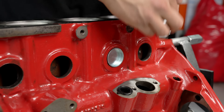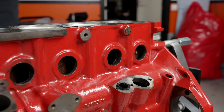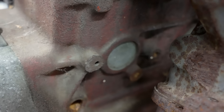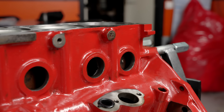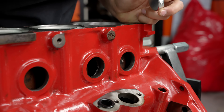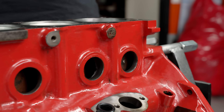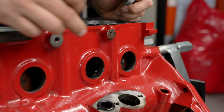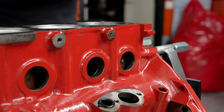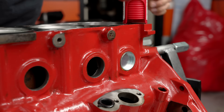We're not going to worry about pre-filling or anything like that. So these are the frost plugs — these need to go here and you just kind of put them in place and whack them in there. These can go on several different ways. If we have a look at the B230F over here, we can see that one has a different type of frost plugs — the big dished type that you got to put a dent into. Some people say you should not have any type of glue or silicone, but I would say put something on here because the surface in here is very rough and the chances of it starting to leak are basically guaranteed. So I'm going to use some Loctite 577 on here.